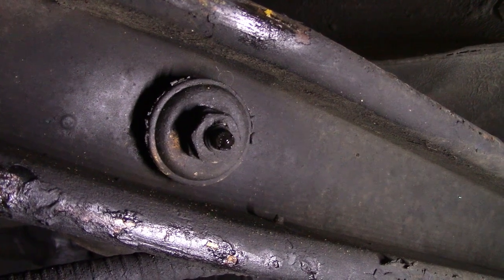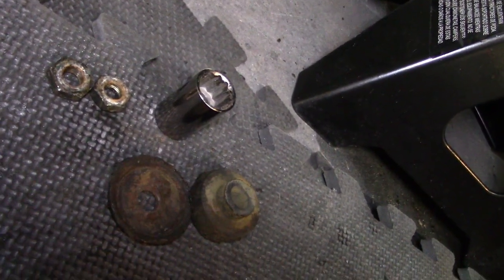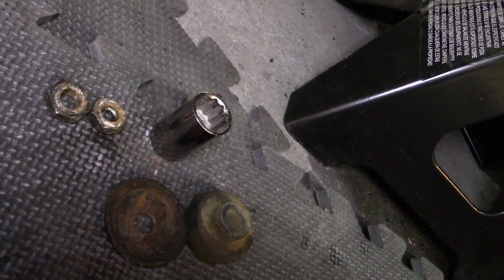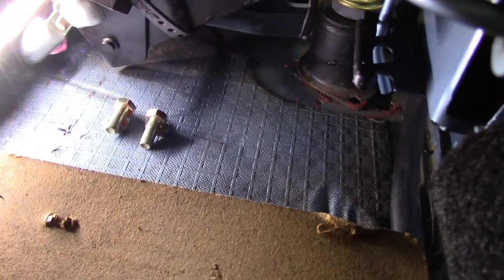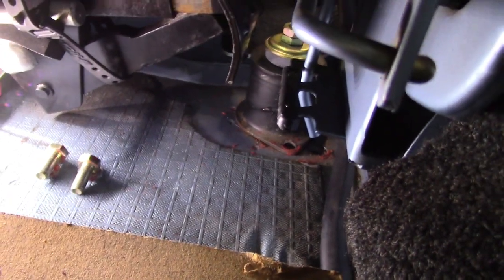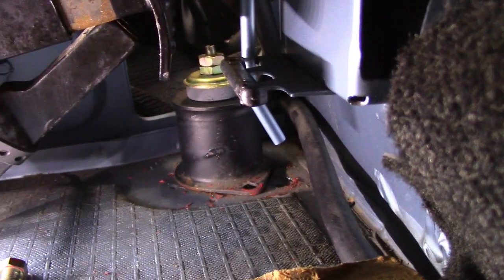Quick look at the bottom hardware: bushing, plate, and two nuts holding the bottom of the shock - the larger is 19mm, the smaller lock nut is 17mm. Moving up to the top of the car, those two bolts holding the top of the shock to the body are 13mm with lock washers and what appears to be red Loctite. We'll put Loctite back on during reinstall. We're going to transfer that little top hat piece to the new shock.